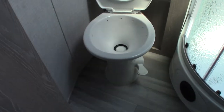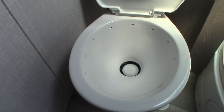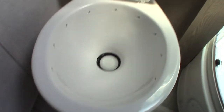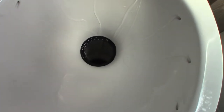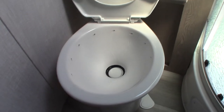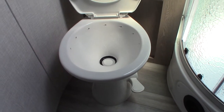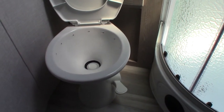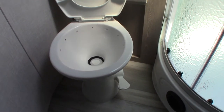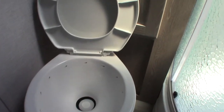The bathroom works like any other. You always have to put chemical and water in the toilet before you use it. When you get to the campground, hook up power and water, dump a dose of chemical in the bowl, step on the pedal — water will come swirling in — and put about a gallon or so into the tank below. Let the water wash the chemical into the bowl and you're set. If the black tank is dry the smell will be terrible and it can also get clogged, so you must do this before using it.